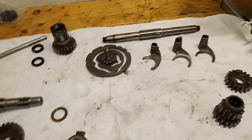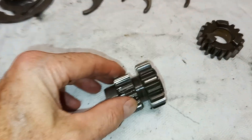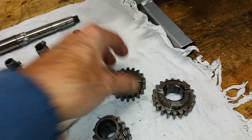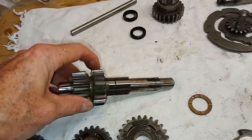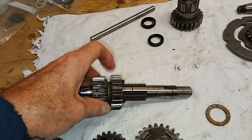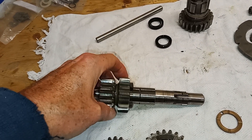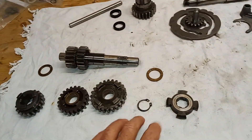I've gone through and checked all the gears, looking for pitting on any of the actual gear teeth — there's no pitting at all on any of them, and no sign of any appreciable wear. I've also checked that fourth gear is spinning freely on the lay shaft and not binding with the main gear, so that's all good.